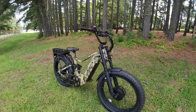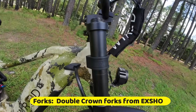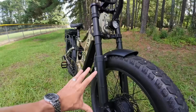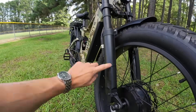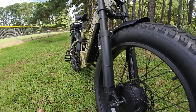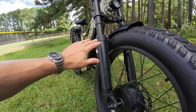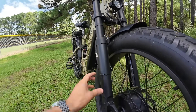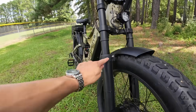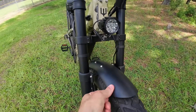The Predator is the only bike that gets the double-crown forks. These are X-Show inverted front forks — the part that compresses is down here. Behind this aluminum fork cover, which protects the fork and also serves as the fender mounting point. It's a solid piece of aluminum bolted in right here on the fork, and up here you can see the fender is attached to that.